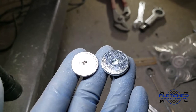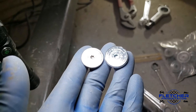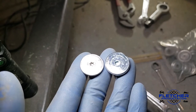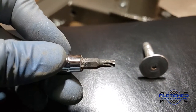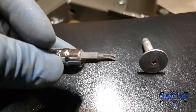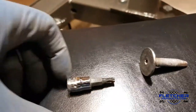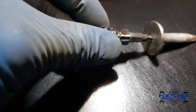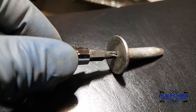Let's take a look at the two different studs here. The original competitor's stud is on the left and the new Snow Studs stud is on the right. Snow Studs uses an Allen head versus a Torx head on the competitor stud — a big difference in grip when you're trying to take these off. After just one attempt to remove a nut, the Torx bit twisted almost immediately. You get corrosion between an aluminum nut and a plated steel stud, and you just can't get enough grip on a Torx bit to get those nuts off when you need to.